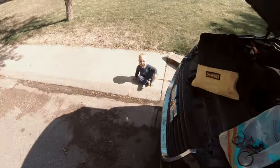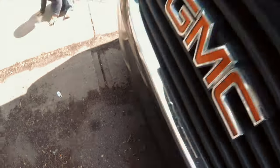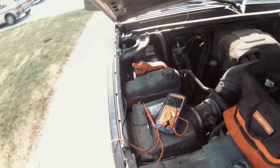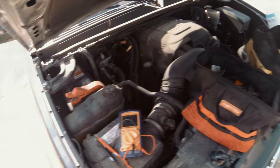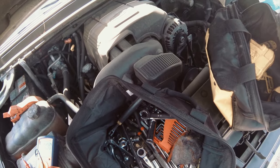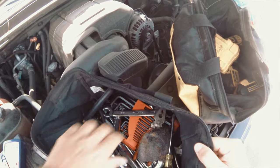Nothing — so that's either a bad battery or a bad alternator. With a bad alternator it would die while you were driving eventually. With a bad battery it'll drive fine, but if you let it sit it'll crank hard, real slow, or not at all.